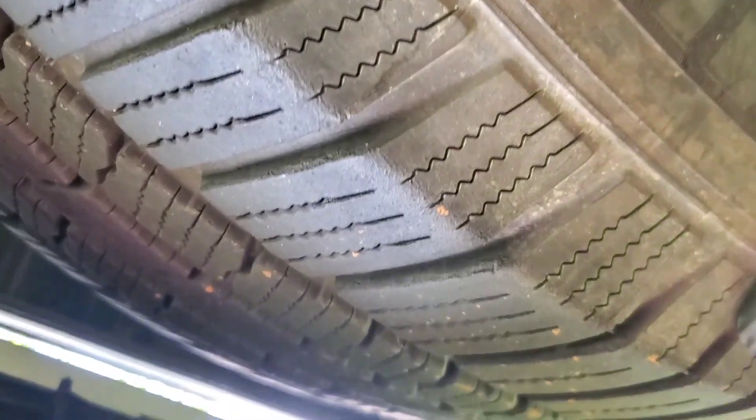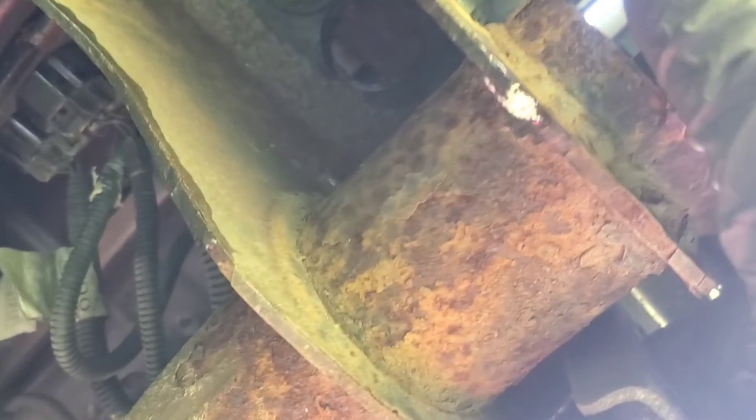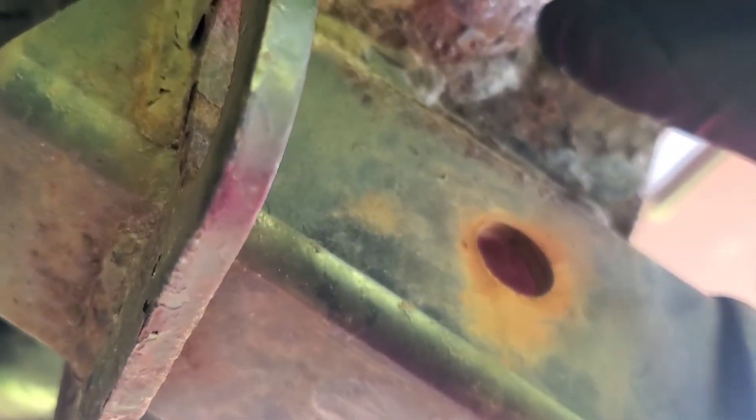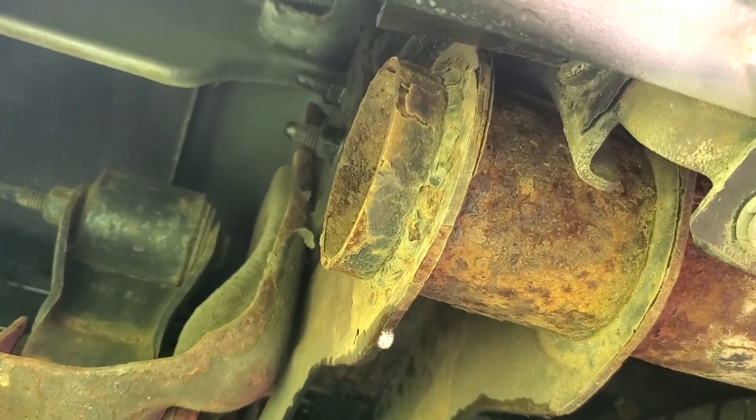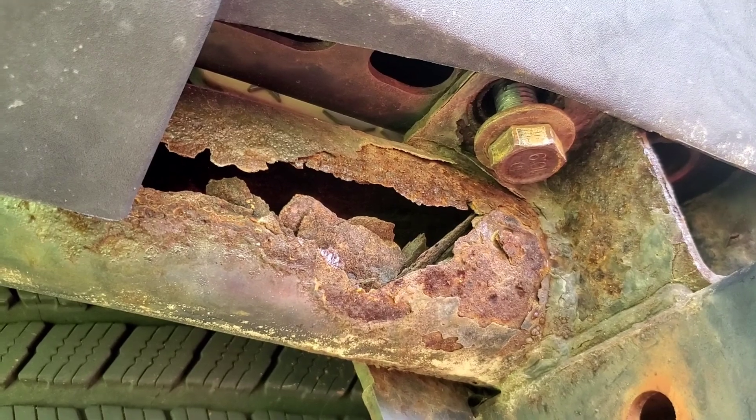On the bottom of the vehicle you may have to remove your spare tire if you have one mounted back here. As you can see, my hitch is rusted out — that's probably from pulling my boat to the lake. The hitch is a hollow tube, and that tube has been holding water. Water gets in from when I put the boat in the lake and just sits on the bottom piece, rotting it away from standing water.